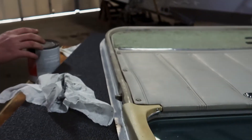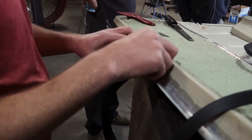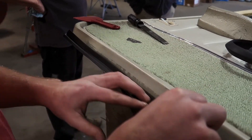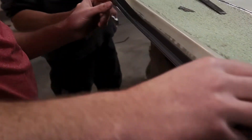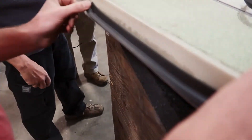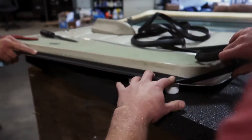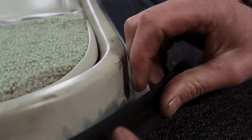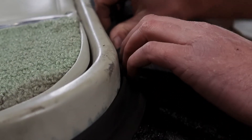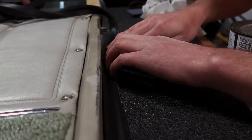I need to put a little bit of MEK on that and thin it down a little. I'm going to go get the seal — we're ready to stick it on. They don't tell you, it just says fat side down. Fat side on the frame — one side thicker than the other. I wouldn't put it too close to a curve; I'm going to do it right in the middle. That looks like a pretty good seal, it's a really good seal. Are you using that 3M stuff? Mm-hmm — monkey snot. We call it gorilla snot. It's 1300L is what civilians call it.